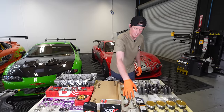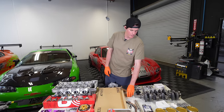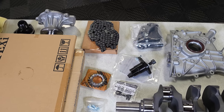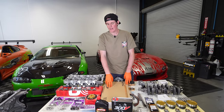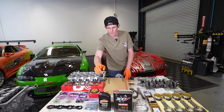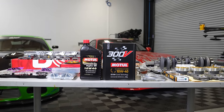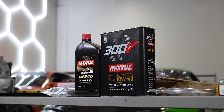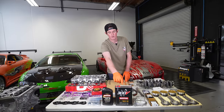For OEM parts, we have the rear main housing, all the timing guides, new hardware, the timing chain kit, a lower gear, and a Masworks mechanical timing chain tensioner, which is a good upgrade over the stock one. We also have a Nissan Master Engine gasket set, and we're going to be running an Apex head gasket. We're going to run the engine in on some 10W40 Motul break-in oil, and once it's broken in, we'll switch to a 10W40 300V racing engine oil.